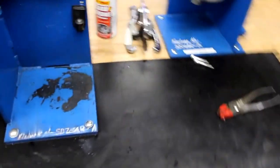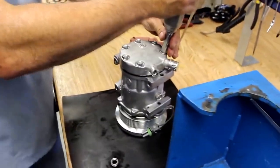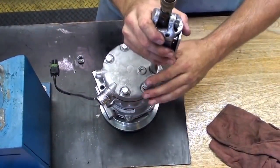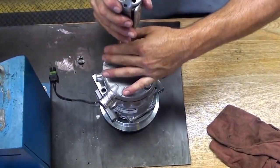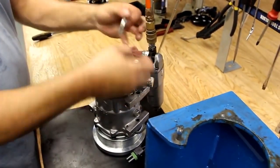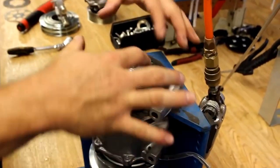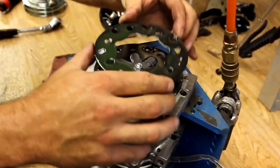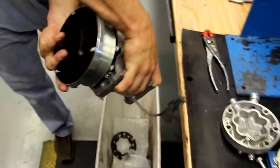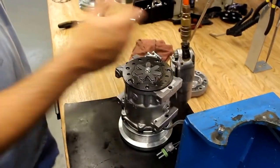Moving back to the compressor that we're going to do the conversion on. 1/2 inch, 13mm socket. Removing the bolts, I pulled the backhead off and immediately the oil is running down into these bolt holes. So I'm removing the old gasket, taking the oil, holding the valve plate on, and draining it out. Always replace your gasket.